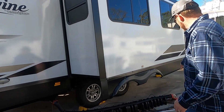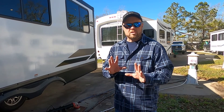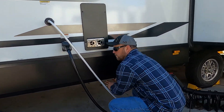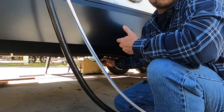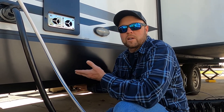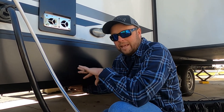Once this slows down — see it's starting to slow down now — we're getting close to it being completely drained. This is just the black tank now, completely drained. So what we're going to do is come back over here and shut this valve. So now the water is still going into it. What we're doing is allowing this black tank to fill up with fresh water, because you want it to fill up to get all that head pressure to push out any solids that have been broken down. We're going to give that a minute.